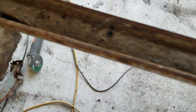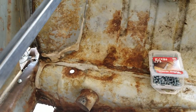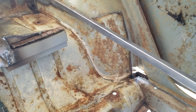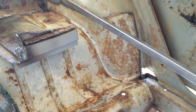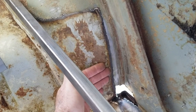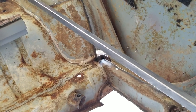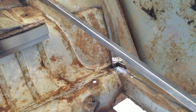I've got a clamp and weld and all that, but I'm even thinking about taking this panel out and coating everything with panel adhesive, setting it in place and doing a little less welding to save myself some work. A lot of guys say panel adhesive isn't strong or doesn't work as good or isn't original, but panel adhesive is awesome - it works great if it's done properly on bare metal on both surfaces. It also prevents rust between the two layers. As for weld-through primer, I'm not real confident that actually works - how can you have a primer you can weld through where the heat doesn't cause rust?